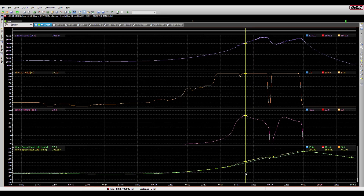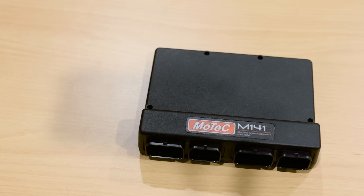The problem with using ignition cut is that it's quite hard on the engine — it's effectively the same as an engine speed limiter. If you sit on the limiter all day, you're likely to break a lot of different things. To prevent that, other systems should be used such as reducing boost level and reducing ignition timing, which work quickly at reducing torque and producing consistent torque. What that means is you're not interrupting it — going from 500 Nm of torque to the rear wheels instantly down to 100 and back to 500 again — because that shakes the tire, shakes the driveline, and causes more problems.